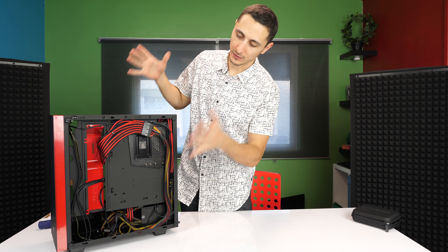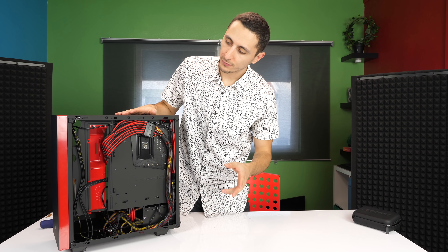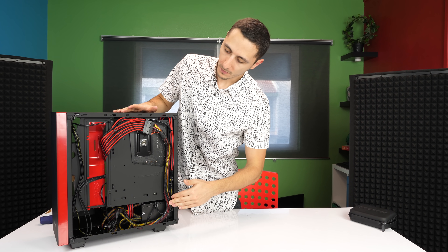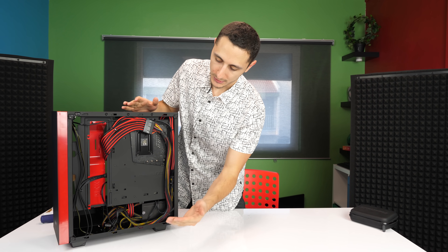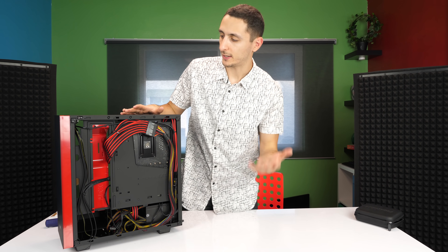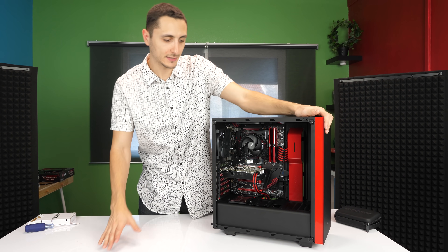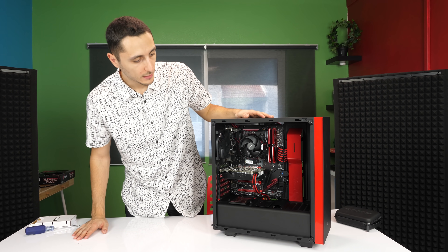I just finished cable managing the PC. To give you some tips: make sure to use Velcro straps or the zip ties that come with your power supply. Find a few routes for the cables — don't run them down the center. Try to find a discreet pattern; some cables run on the left side and the rest on the opposite side. Bundle any excess cables you're not using, zip-tie or Velcro them together, and push them inside next to the hard drive bay. This case has plenty of space to hide unused cables. From the front it looks very clean and organized, with lots of space for future expandability — an extra space for an SSD, a bigger cooler, or even a radiator in the front.